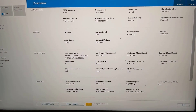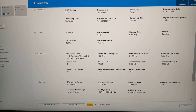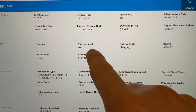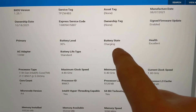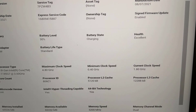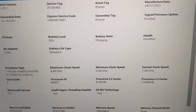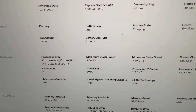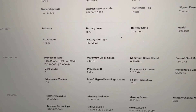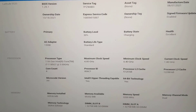After the new battery has been installed, I recommend turning on the laptop and pressing F2 to enter the BIOS. From here we can see that the battery level is currently 30%, it's charging, and its health is excellent. Just be aware that sometimes new batteries come at 50% or lower charge — in this case it came below 30%. I've seen them occasionally come completely depleted, so you may need to charge the laptop for a few hours to get the new battery fully charged.